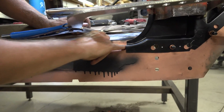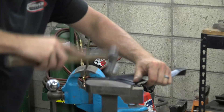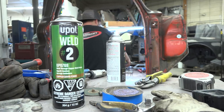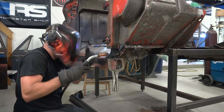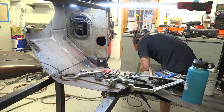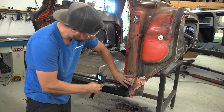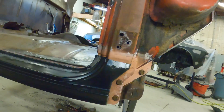I need to drop and close this gap here. Yesterday I finished getting all the inner structure in here and the A-pillar all the way down to here — grafted it up, got that replaced, got everything fit again, refitted the rocker, and then got the rocker fully welded on on the passenger side.